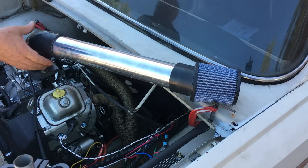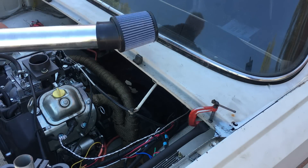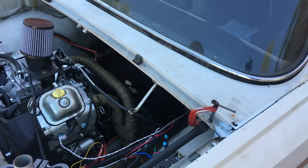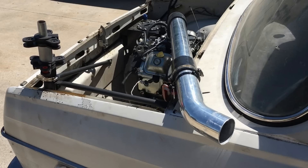I did a bit of research, and apparently the RAM air carburetors like those used on older Pontiacs are calibrated differently. What we're doing with our makeshift RAM air system is putting positive pressure into the carburetor, and it's upsetting the way the Venturi works. It gets really complicated after that, and the short story is this probably ain't going to work on a lawnmower carburetor.